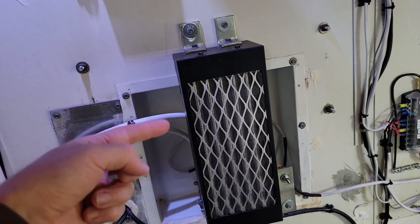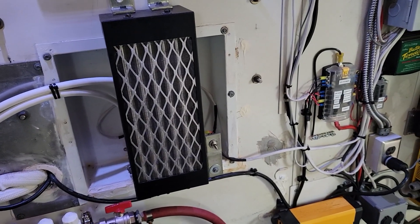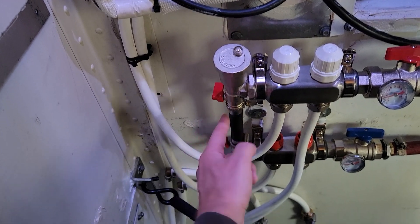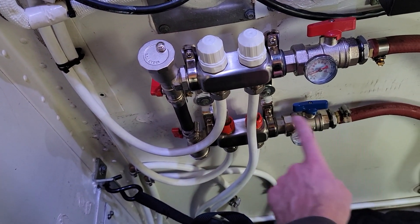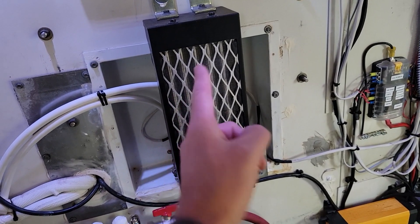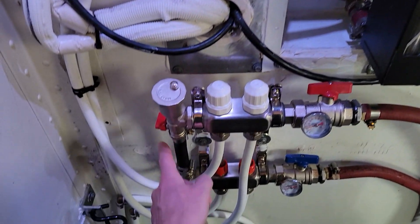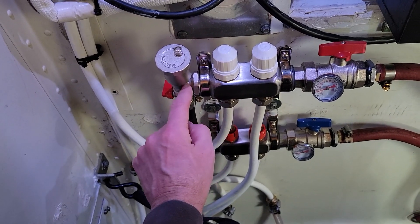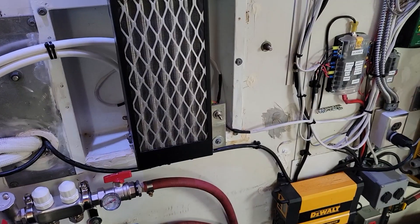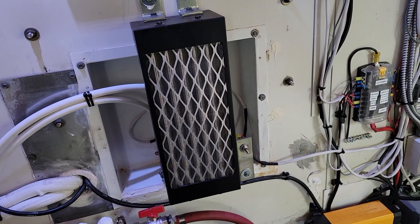The motor's water pump will pump coolant through this loop without the use of the Eberspacher, so you basically heat the shelter for free while you're driving down the road. The reason I put in this bypass is — if I open this valve, coolant passes straight back to the motor and doesn't go through the flooring or the radiator. We got tired of coming in the shelter in the summer and this would heat it up more than needed, so this valve creates a loop straight back to the motor to eliminate the excess heat buildup in summer.